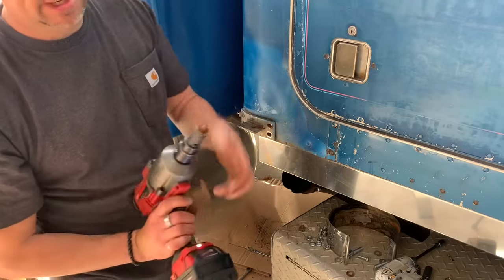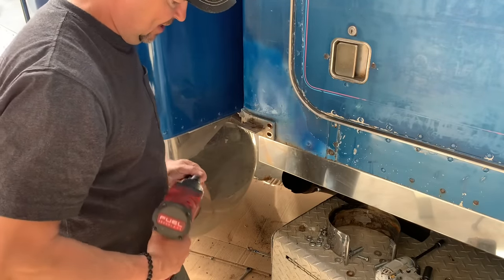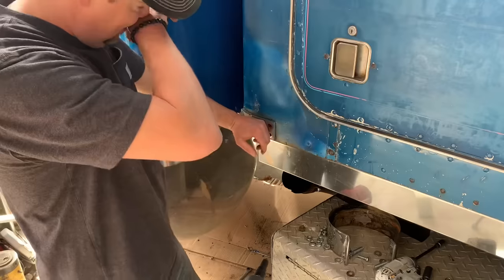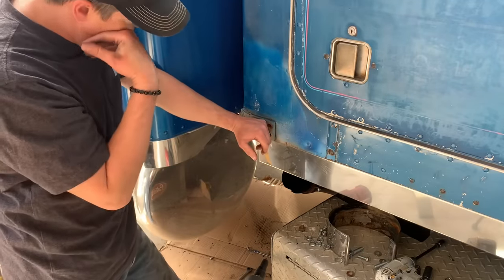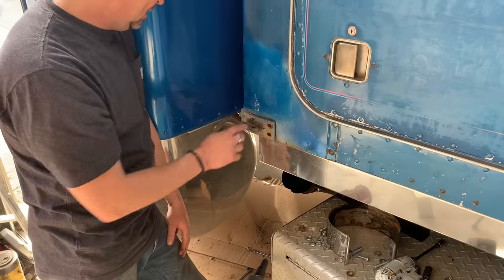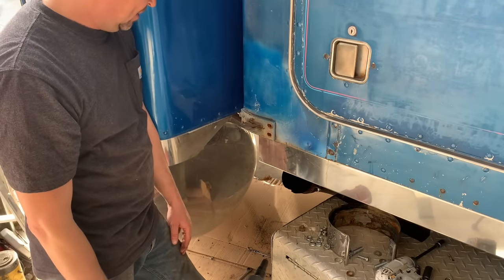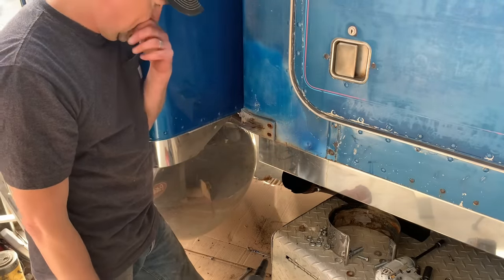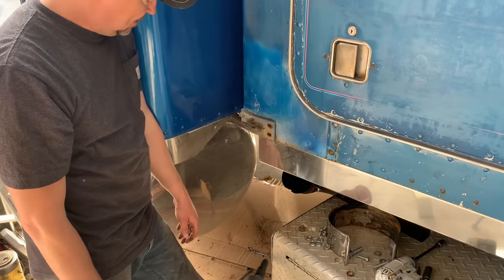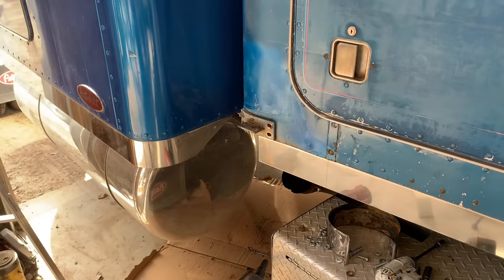And yeah, there you go. Because these are actually nutserts, or nut inserts on the back side. So now this just grew into a bigger project. So I'll have to take this off of here. Maybe we'll clean up the metal a little bit and then we'll drill through. Oh man, it's gonna be a bit of work. And then we could put a nut on the back, maybe a nylon lock nut. Oh, what you think's gonna be an easy job turns out to be a big one.